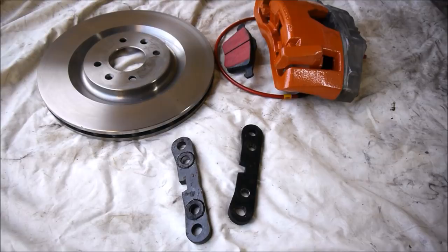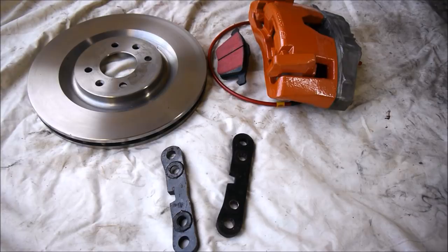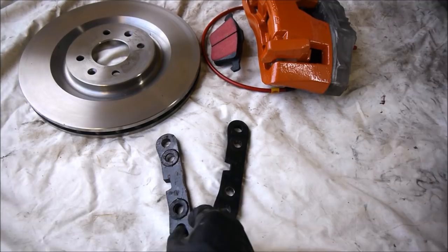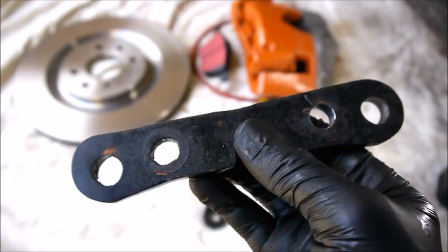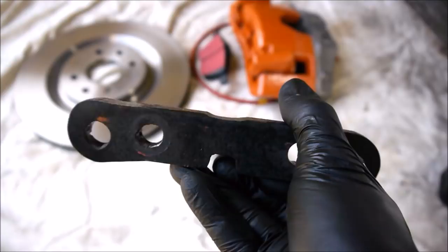As you may or may not have seen, I was measuring up some adapters — that last bit of video was shot in October 2017 and it's now June 2018, so they've taken quite a while. I had other issues in the meantime — two engine rebuilds for instance. The adapters have arrived, but I'm afraid I can't recommend the company that made them. They've not been great: if you look carefully through the holes you can see lots of Dremel marks and the original cut marks, especially these two holes here. The holes weren't true or square to the plate, and I've been Dremeling away on it this morning because they don't actually fit right.